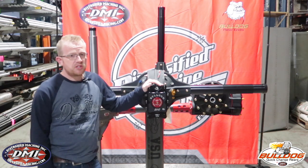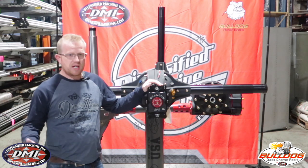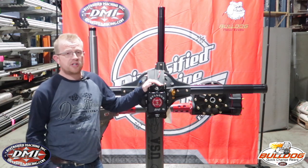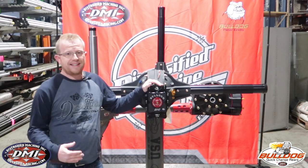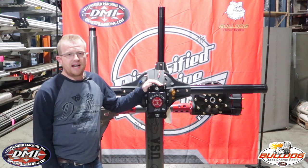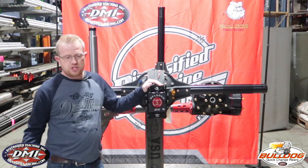The 8 inch ring and pinion will have a shorter service life to it than a 10 inch. You're basically going to take X amount of force that your car provides — for sake of a number, just say 1,000 pounds of force going through your ring and pinion — and you're going to either dissipate that energy over an 8 inch ring gear or a 10 inch ring gear. Obviously, the larger ring gear will have a less concentrated amount of impact on it per square inch.